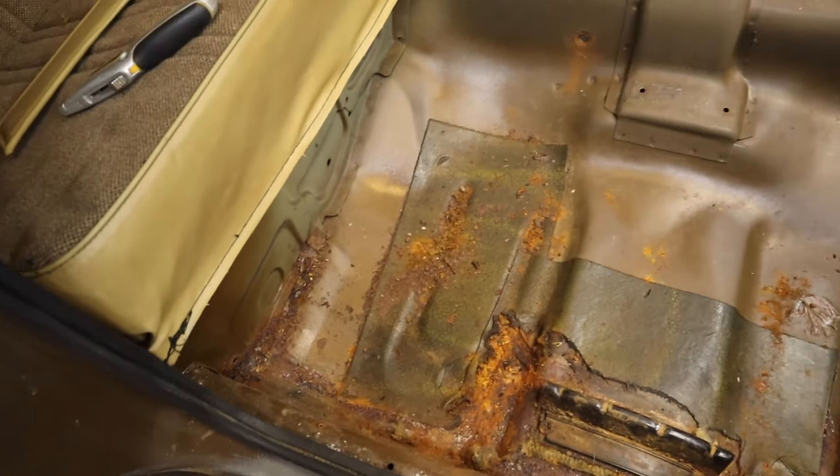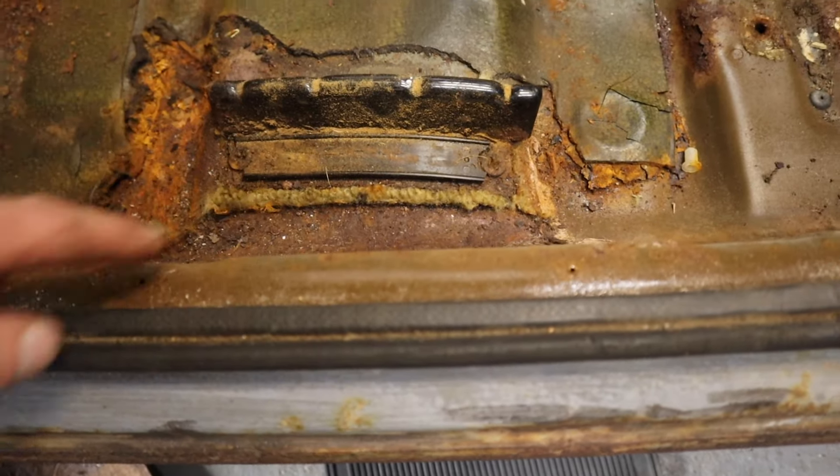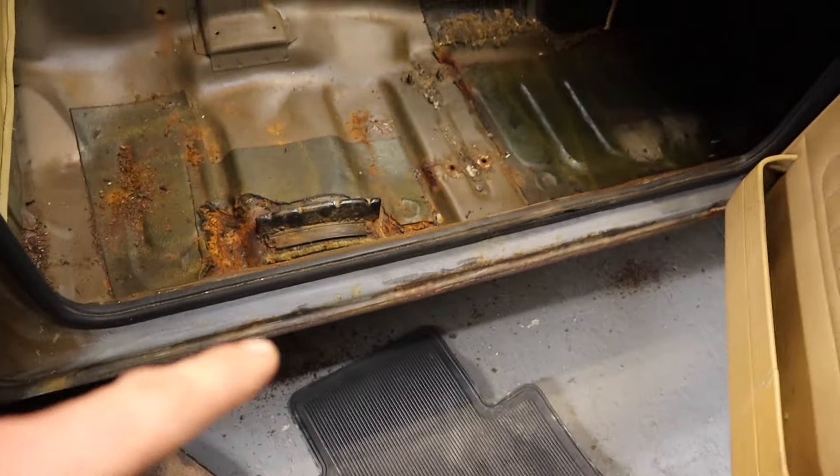The floor overall doesn't look too bad. A good scrape back will tell. I've got to drill out these. And this part of the floor here looks rotten, so I'm probably going to have to fabricate a new section there. And up here is obviously very cancerous. But we know about all that. Where we can see outside - this sill here is the questionable sill. Let me know what your thoughts are at this part of the build - is this better than what you expected?